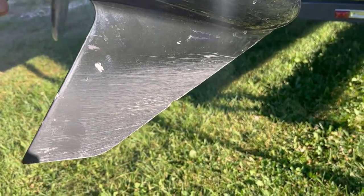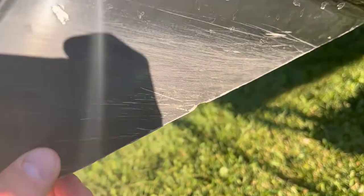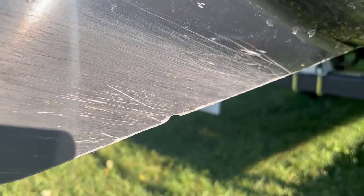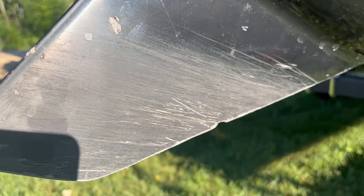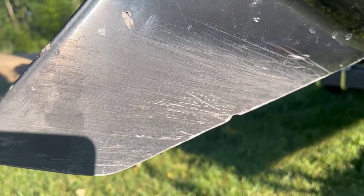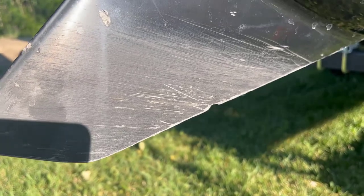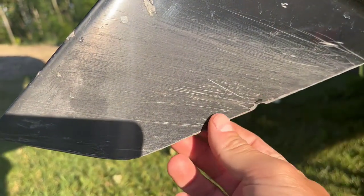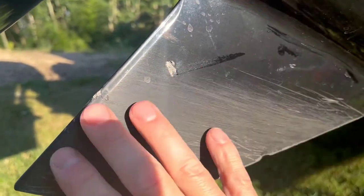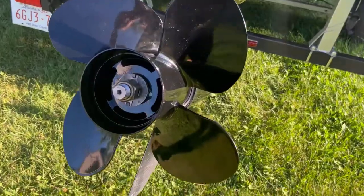What other damage did I do when I hit that rock wall underwater? It's not too bad — mostly cosmetic, a little chunk out here and a divot out there. There are skeg guards you can put on the bottom and in some cases even replace this piece. When I saw those rocks, I immediately threw everything into neutral and started hitting the trim up button as quick as I could — I wanted the motor no longer spinning under its own power, hopefully just dragging in the water to lessen the damage. I'm going to JB weld this, mask it off, sand it up nice, and paint it. Not too concerned — this is a pontoon boat, not a speed boat.